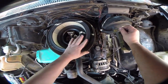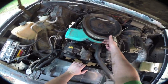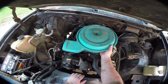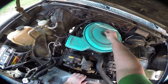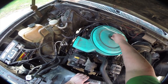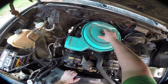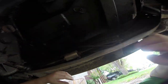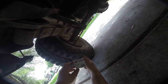On hot rods you can try the flipped air cleaner trick, but on a truck that's going to see off-road time in the dust it's really better to keep that sealed — eventually we'll build something or figure out another way. Next thing we're going to tackle is the fuel filter. I got a new one from CarQuest, part number 86481.